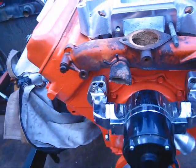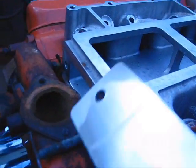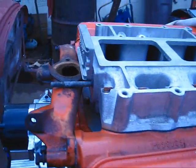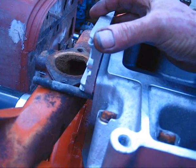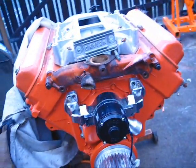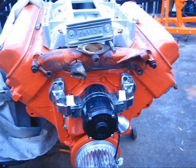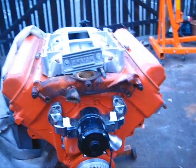This is cast iron, so I might be able to weld it up. This pop-off valve here is pretty thick — it's not going to really work in there; I'd be into my water jacket. I can make a thin one, though I'll still have something to do with the springs. It might be better to just go ahead and continue with my original plan of making a crossover tube. But anyway, it gives me one more option.